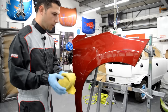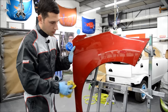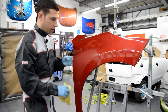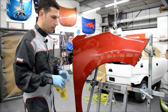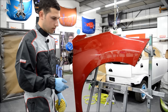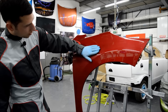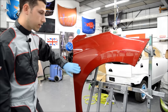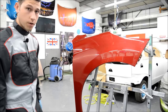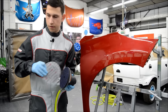We've just gone over that with the 3000 — we'll give it a dry with our microfiber. I normally use microfibres all the time when polishing, even when flattening dry or with water, because we don't want dirty rags. That's the P3000, and straight away you can tell it's a very high grade — you can start to see a reflection now in the paintwork.